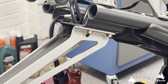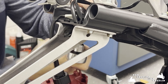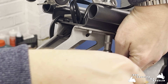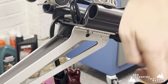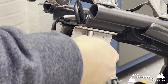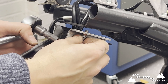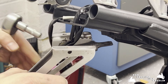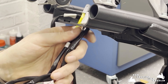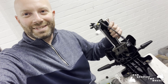We're going to use an eight millimeter socket to remove these four bolts on the underside — these are the ones actually holding the number plate holder. We'll pull this out and then carefully guide those three cables that we undid through the opening and pull them out through here. So what we now have is the large cumbersome number plate holder and indicators removed from the bike.